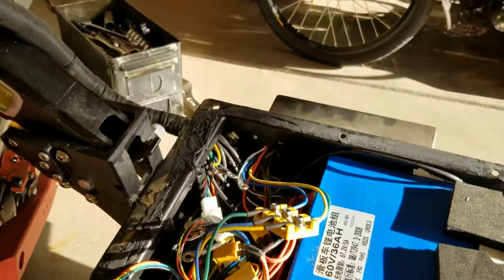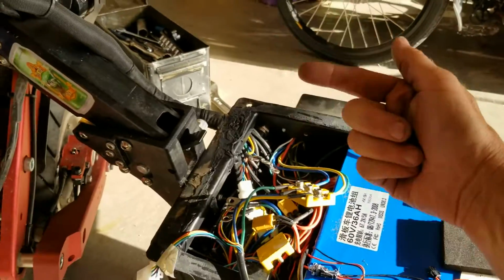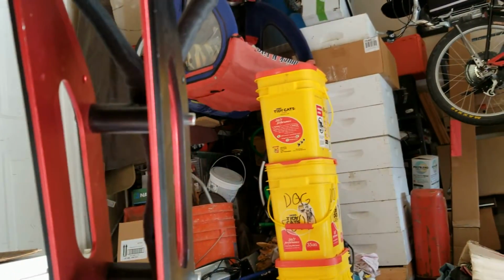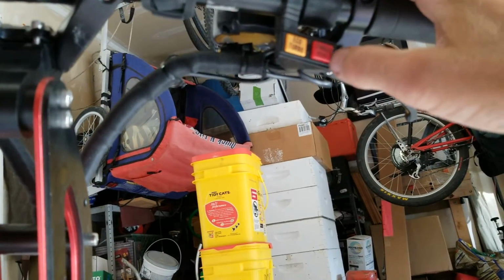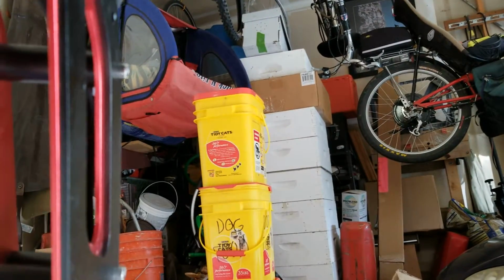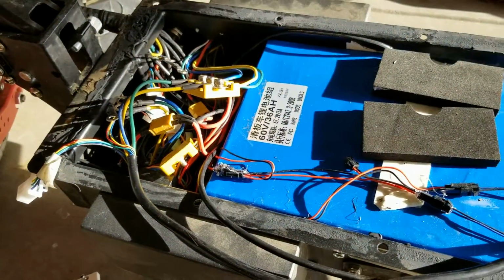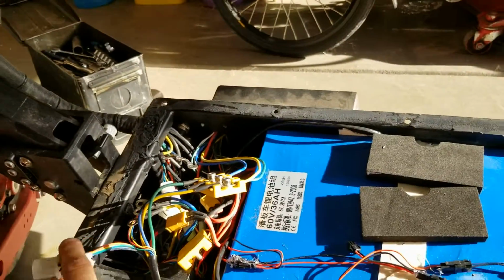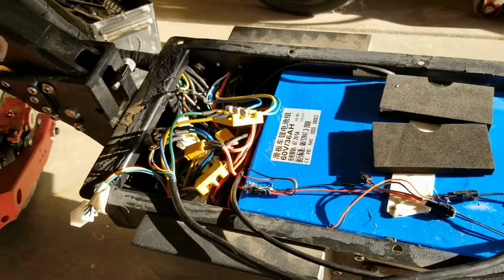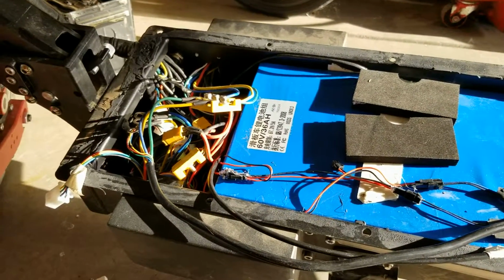So that is the rear wheel to the front controller, which is known good because I can still ride it with just the front wheel. And I've got the front controller on right here. You can see. Turn it on. Whoop. Must have turned off. So it turns off, it times out because of the rear hall sensors. The rear controller isn't hooked up, and that's what the controller senses. The throttle senses whether or not the rear wheel sees speed.